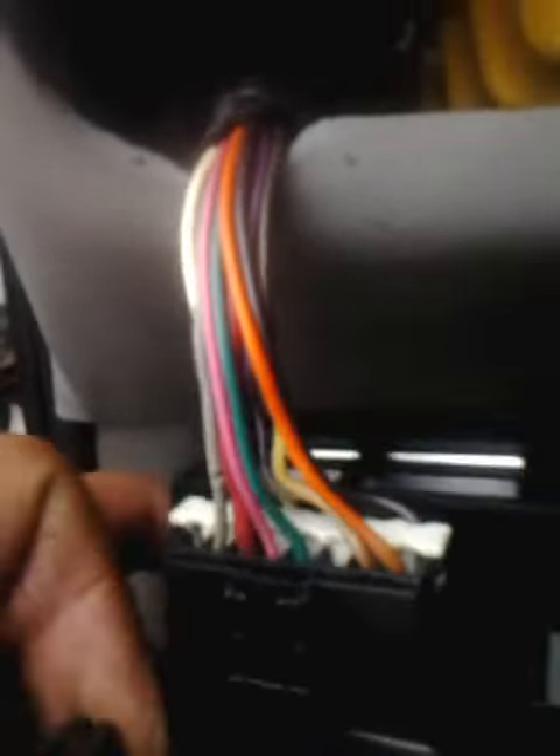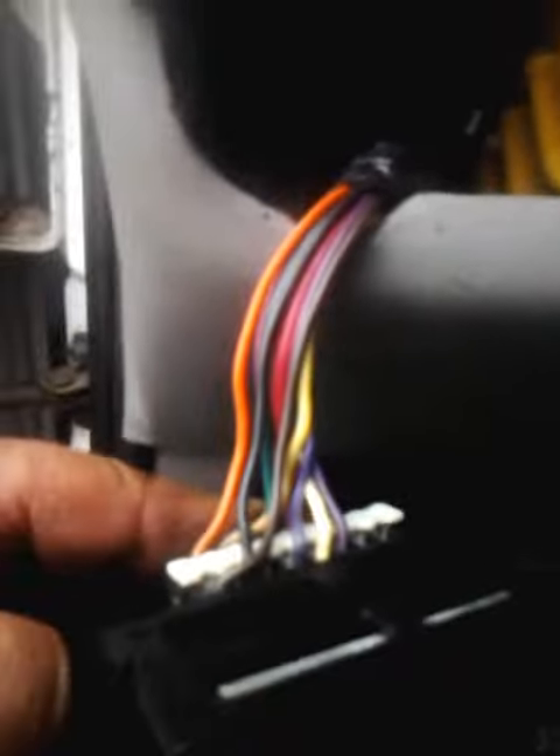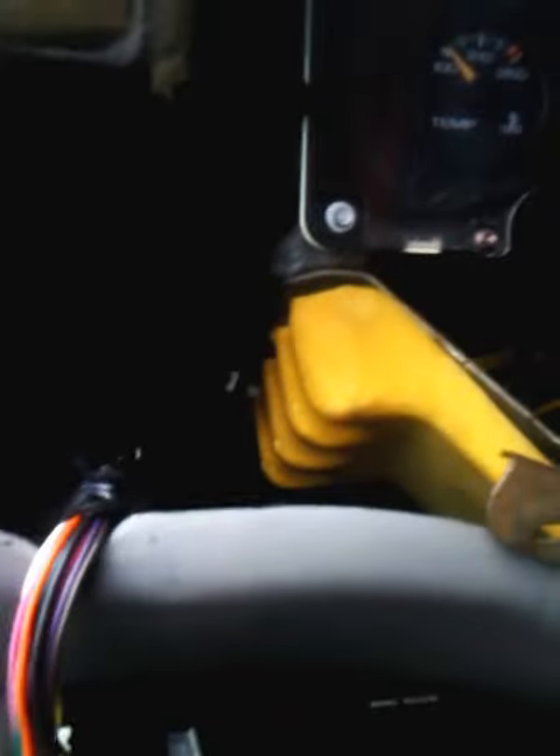Also, the back connector — they often have burned terminals. This terminal had a little dark spot on it, but it was in pretty good shape, and all the pinout connections tested good. Checking the fuse box down here on the lower panel by the kick panel — all the fuses tested good.